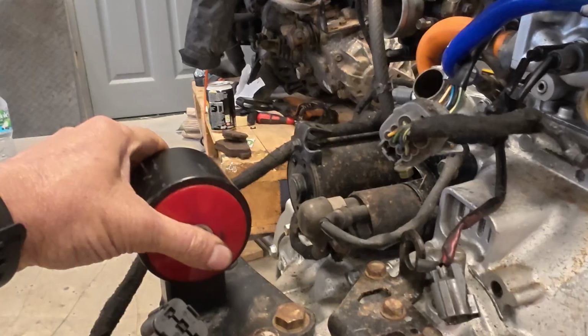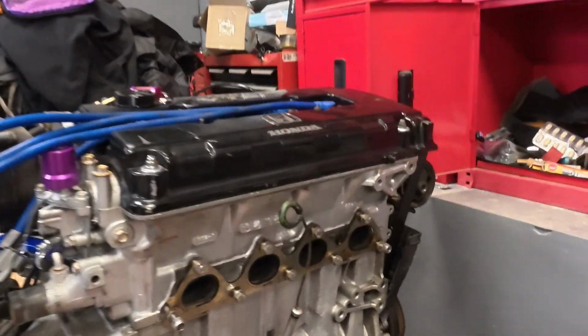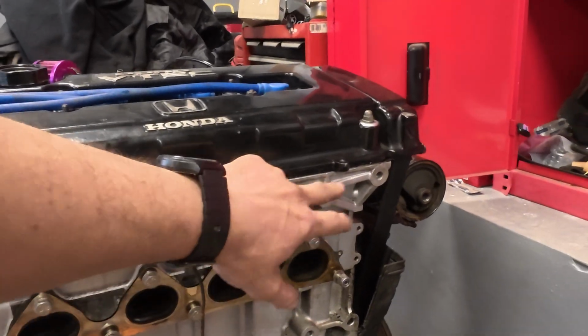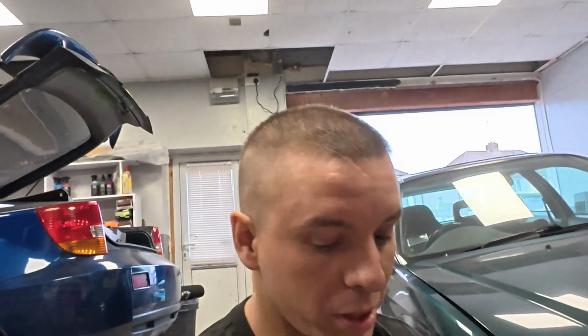And I've just noticed here, obviously, polybush gearbox mount there. But like I said, I've seen it running, so I am excited. The one thing I am going to have to source, which I'm going to need some help off you Honda guys, I want to run power steering. Liam was running this without power steering, so I've heard stories you can use the D-series pump, but you need the bracket, so I do need to look into that, and I'm going to need a little bit of help.